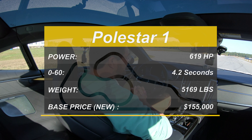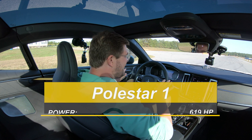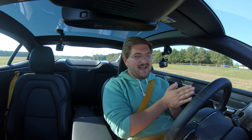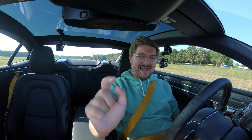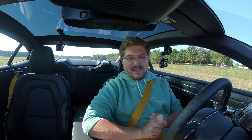There's no way to fully disable traction control. Interestingly though — and the same with all Volvo products — when the brakes get really hot, it shuts off ESP completely. We've seen this in the V60 Polestar, the Volvo Polestar wagon plug-in hybrid, where when the brakes get hot it just shuts off traction control, then they cool down and it turns back on. So you constantly have to keep pressing ESC sport mode. This car is no exception to that.